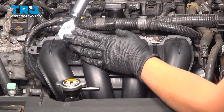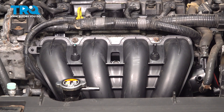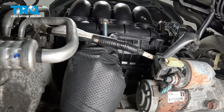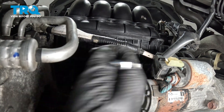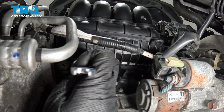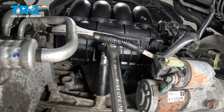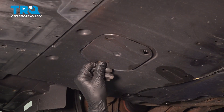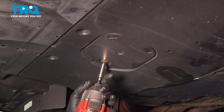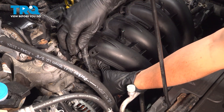Let's double check them all — those are all tight. Now let's install the mounting bolt through the bottom. Snug it up. The torque for this is also 13 foot-pounds. However, I can't fit a torque wrench in here, so I'm just going to get a longer ratchet, put some leverage on it, and snug it up. That's pretty tight right there. Install the cover and put the bolt back in. Snug it up. Let's re-secure the wire with all of the retainers, starting from one side and working our way towards the other side.